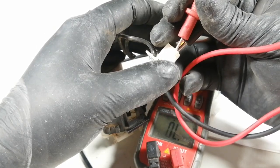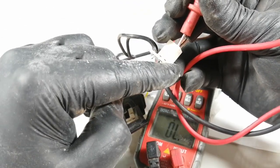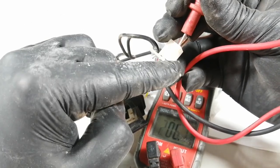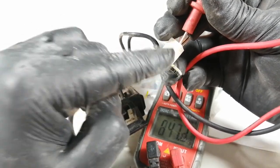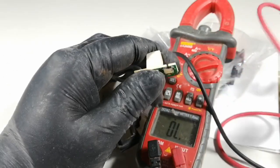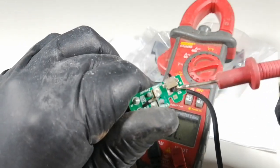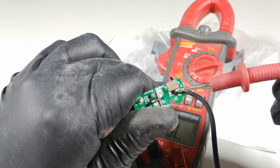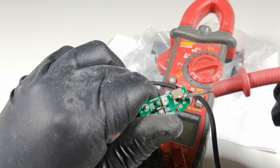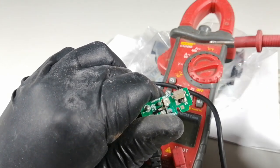This micro switch or switch can be cleaned with isopropyl alcohol. You pour the isopropyl alcohol directly and you press it quite a lot. That will make it remove the dirt. When removing the dirt, you are going to have a clean continuity, or you can also replace it. This is not expensive, they sell it to you for about 30 to 40 pesos, up to 100 depending on where you buy it. Better not to change it, buy a new actuator, but then buy in quantity. They cost you up to 15 and most are 3 or 4, so it suits you to buy one like this.